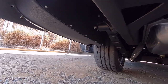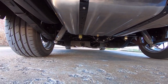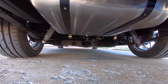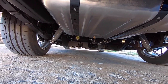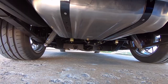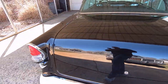The shocks are Toxic shocks made for lowered vehicles, a little stiffer than average. They came flat white, so I had the paint mixed to the new Dodge destroyer gray color. The leaf spring perches on the rear end and all the sway bar brackets are completely welded in and molded in. The rear end is high gloss so it looks like it was cast, and I even speed-holed and stepped the webbing on the rear end.